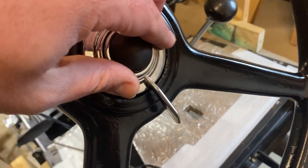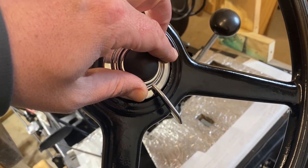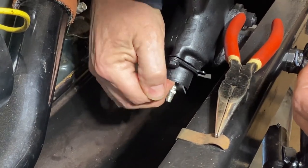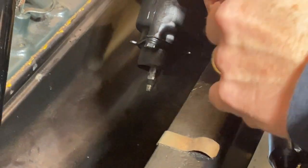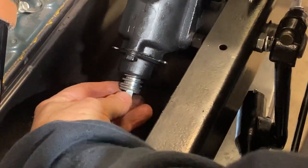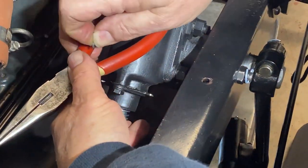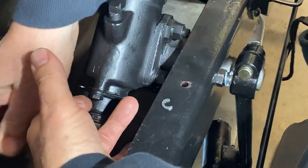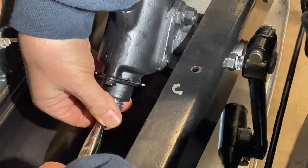To help make the spider installation a bit easier, it helps to have someone hold the top of the rod in place against the steering wheel. First put that rubber washer up in there, then we've got our spring. I've made sure I've got my top marked, and I've got my light switch rotated to the bottom position up there where it should be. And the spider — remember, the spider's got to be oriented straight up and down. I'm going to rotate this just a little.